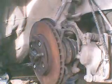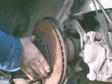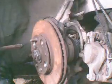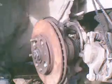It turns out we have an access panel back here. Let me show you that. I'm going to move the camera. Can you see here, when you take the brake caliper out, you've got an access panel back here, a cutout. I'm going to rotate. I've got two broken studs. Maybe I'll just do one here for you, but I rotate it to where I can see the back side of that wheel stud, and then I'm just going to stand up, I guess, and beat it out the back.